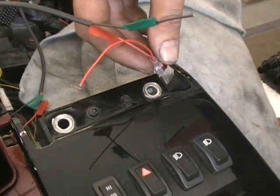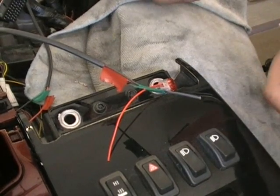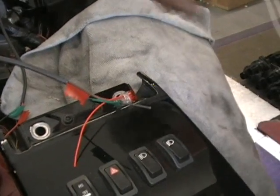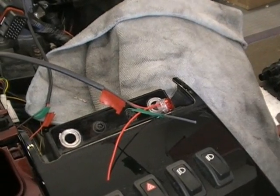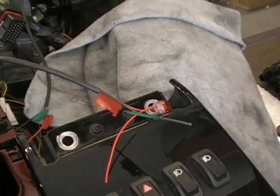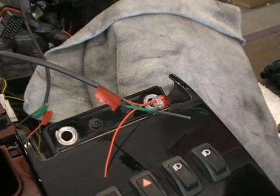So, when you're doing this, one thing you want to make sure is don't have your wire looped on the outside of your handlebar or something like that. Make sure everything is not wrapped around things, because the last thing you want to do is connect this up and then go to bolt it on and realize the wire is on the wrong side of the handlebars, the wire got wrapped around the exhaust pipe, you know, something crazy like that.